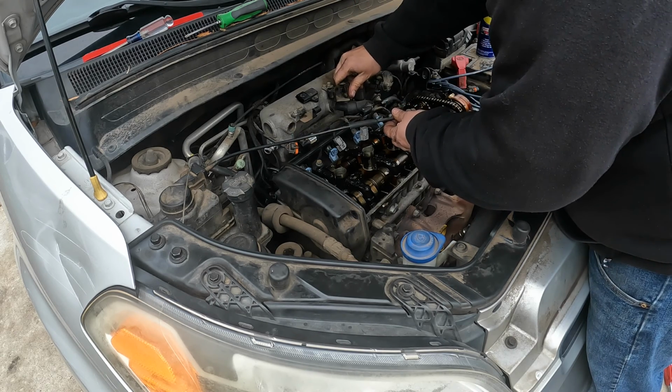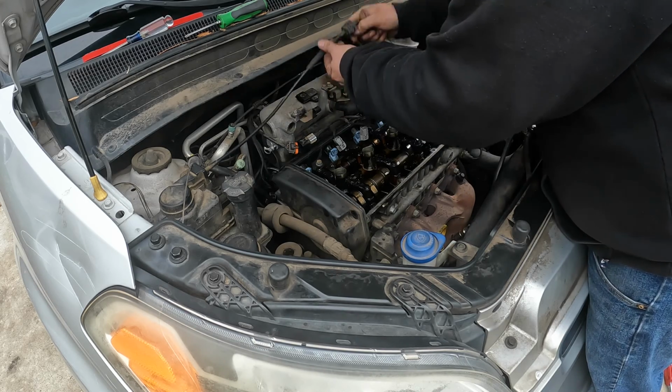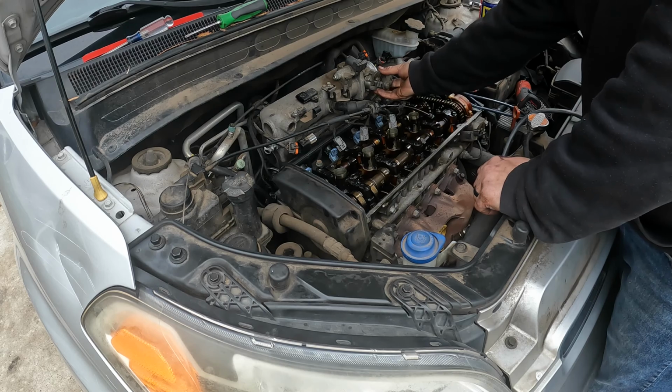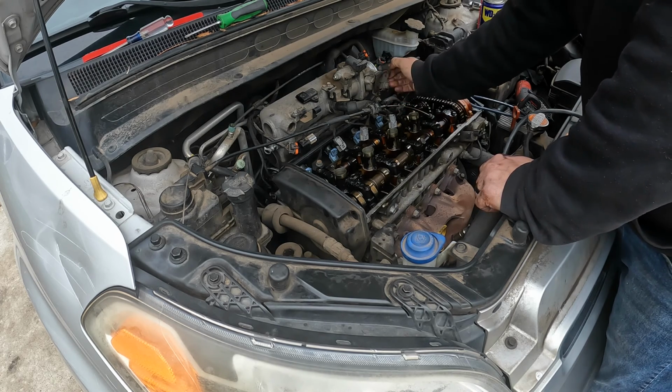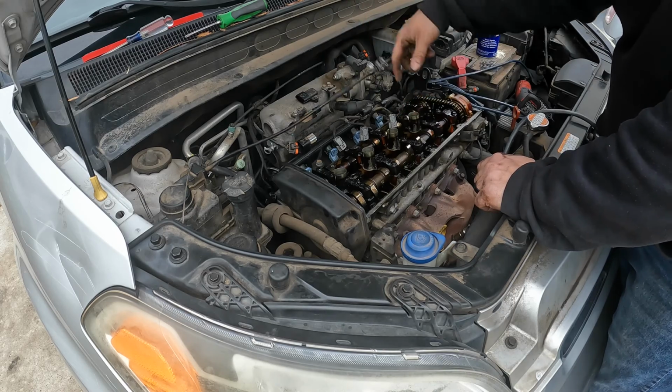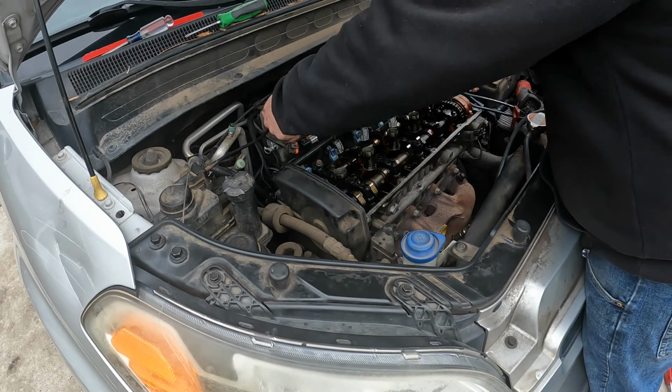They just sit down on top of that and hold them down. But you just pull those off and they pull right out, and then you have to flip the throttle blade back so you can get it, and there's little notches inside of the blades to pull the cables off of. And that's pretty much where I'm at the moment.